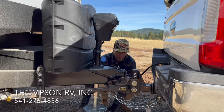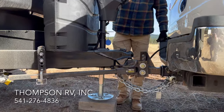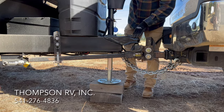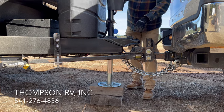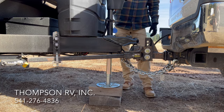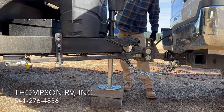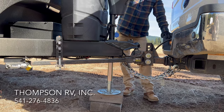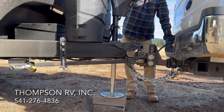I've got my block set here. I'm going to run this jack down. As this jack goes down, we're going to get to a point where we can take the pressure off of this bar and swing it out of the way. I haven't unlocked from the truck yet — I'm still attached so that this lifts in one motion. Now it's starting to pick up the weight. I'm going to watch that bar — it's going to start to slide a little bit. When I see that bar start to move, I know I have enough weight picked up off the pickup that I can swing that bar off.